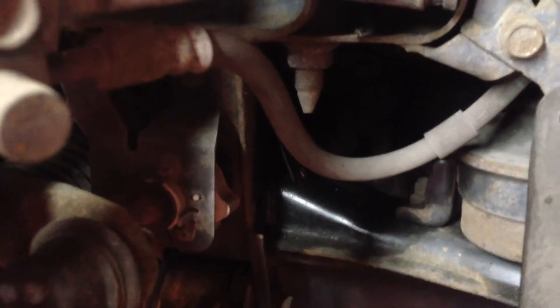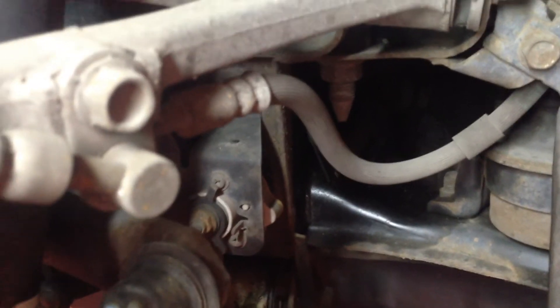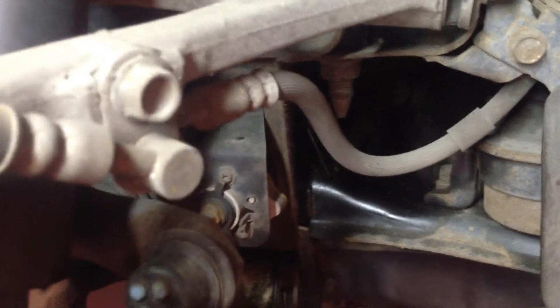You will also find lots of oil normally on the underside of the car — the subframe, lower cross members, stuff like that. Down here in these areas, the lower subframe, you can see there's a little bit on the lower control arm. The subframe is quite oily as well. This is all common signs of cooler hose failure on the RX-8.